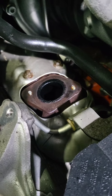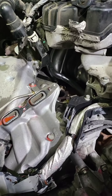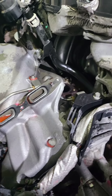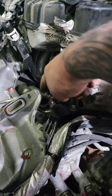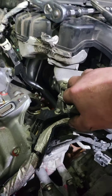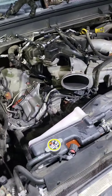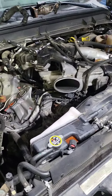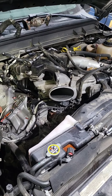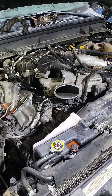I'm going to weld the nuts on them, heat them up, and get them out — no problem. I've had to get them out before when other people broke them off, so it's actually the first set I've broken off myself, but they come out easy. Look how much more room there is on that motor once you take that out. You're going to actually see the motor. This design is sick too — the 6.7s, Ford motors, the manifolds are on the inside, so there's no up pipes or nothing. The turbo bolts right to the actual manifolds. When you shut these trucks off, you don't have to wait for the turbos to cool because all the heat holds in here and cools slowly. This is actually a badass design. I don't care what kind of fan you are — Dodge, Ford, Chevy — these are the best motors out right now. The 6.7s make the most power and they're the most reliable. I got one at home with 600,000 on it, one with 365,000, and one with 42,000 — no problems with any of them.